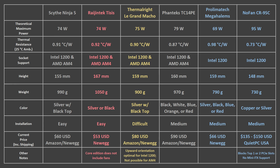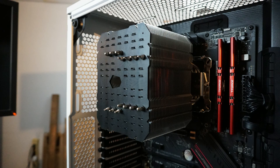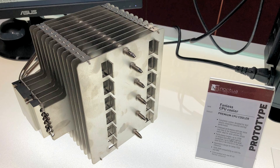A few additional notes: the Thermalright cooler's asymmetric design works well in an upward configuration, which is possible on the Intel LGA 1200 socket but not on the AMD AM4 socket. The NoFan CR95C will block one or two PCIe slots on the motherboard and does not support many ITX motherboards. If you are considering a fanless CPU cooler to help silence a standard tower-style PC system, I hope these results are useful. Keep in mind that the case chosen and room temperature will have a significant effect on CPU temperatures. I am eagerly awaiting Noctua's pending passive CPU cooler, which is on their roadmap for release in the first quarter of 2021. Let me know if there is another cooler you would like to see me test passively in a third passive cooler showdown.